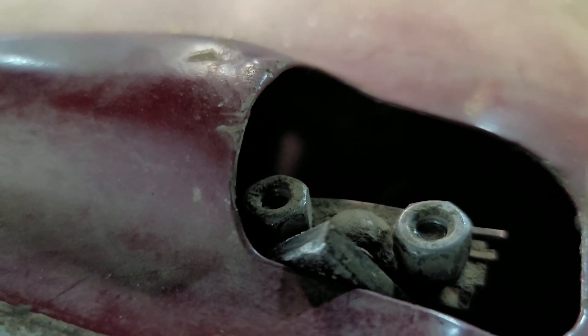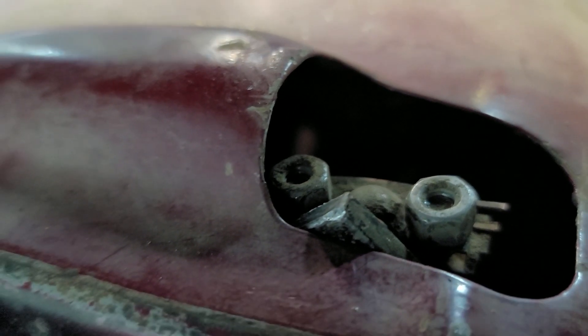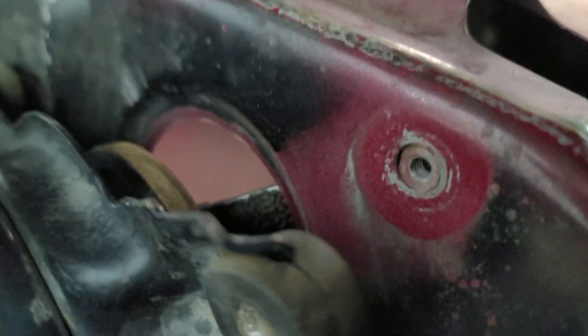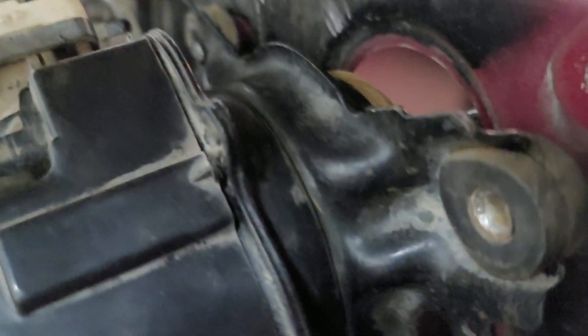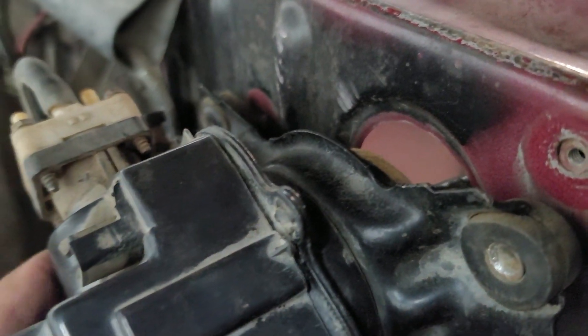You can just lift that top cover off the ball joint and slide that arm out. But if you're not able to get over there to do that, you're gonna have to try to get behind it and get that nut — I think it's a 7/16-inch nut on the back side — to get that arm off. You'll probably have to pry it off because it's gonna be stuck on there pretty good.